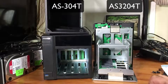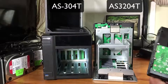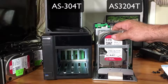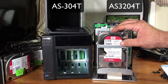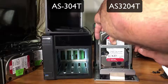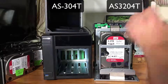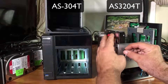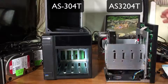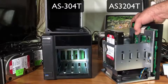Here's inside the NAS - you just take the drive as it comes out of the bag and slide it right in. It has a little sled in there and you push it in and push down, and you're pretty much done. You put all four drives in place. There are screw holes on the side of every hard drive, and there are holes where you can put the thumb screws right back in. So this is all one sled - everything gets popped in and you put all 16 screws in.